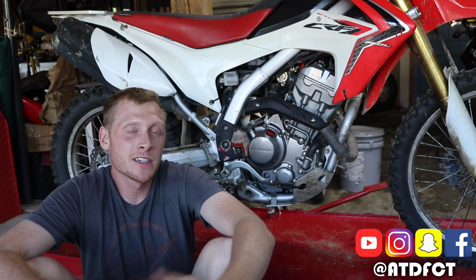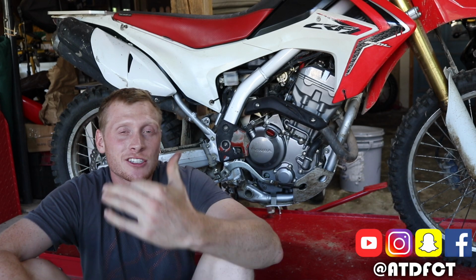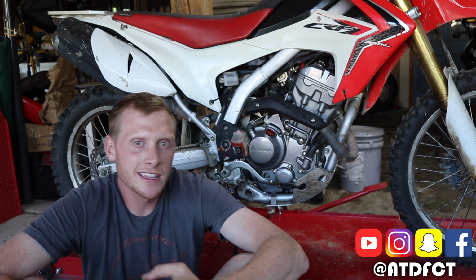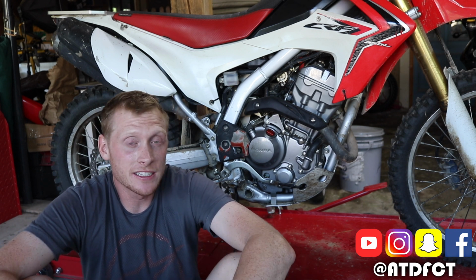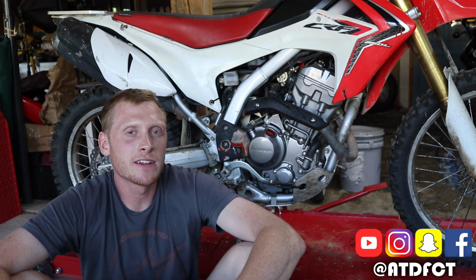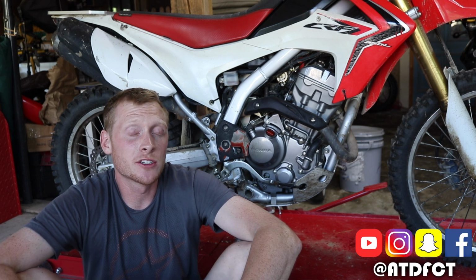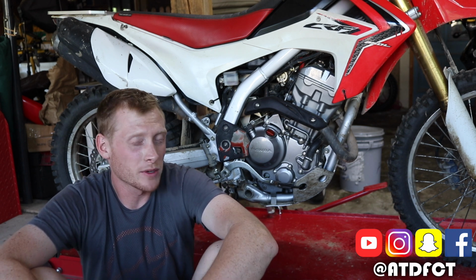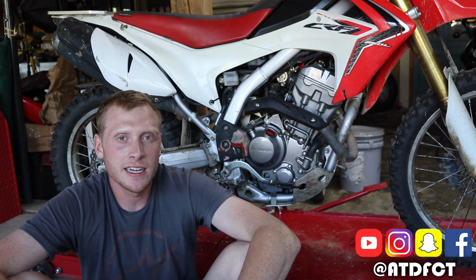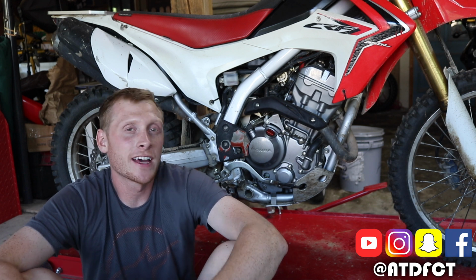Well, that's it, everyone. That's how you change your clutch plates in your CRF250L. Like I said, most all bikes are the same way, so it's a good thing to know how to do. It's relatively easy, so it'll give you some confidence as far as working on other things in the future. So I definitely recommend doing it over taking it to the dealership. I don't even want to know what they charge you for it, but I'm in at like 50 bucks. Things to note, just keep track of everything like I said. Be organized. Watch out for those dowel pins and those few gaskets. Other than that, there's nothing to it.